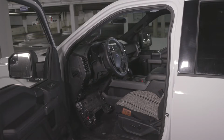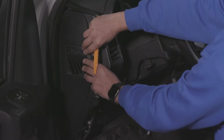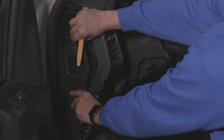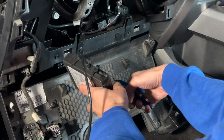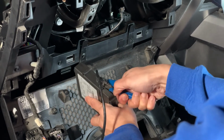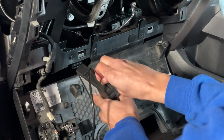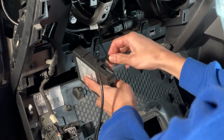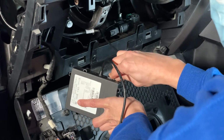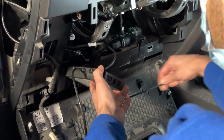Route the wires from the NFC Reader to the Go device through the dash panels. Remove dash panels as needed. Prepare the Iox Keyless. Cut the cable tie and remove the termination shunt to expose the expansion port. Connect the cable from the NFC Reader to the Iox Keyless USB expansion port. Secure the connection using a cable tie.